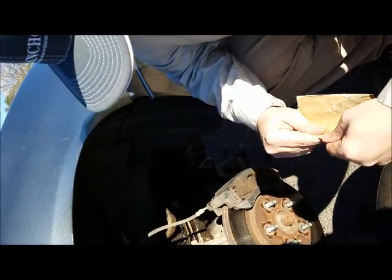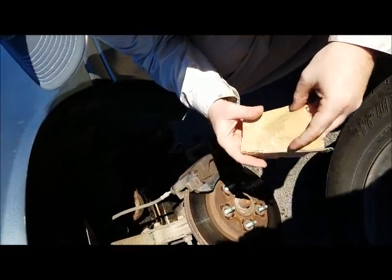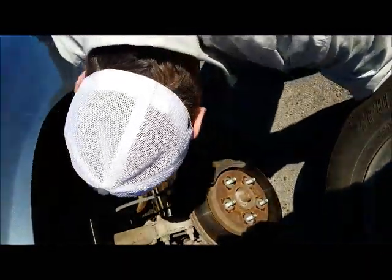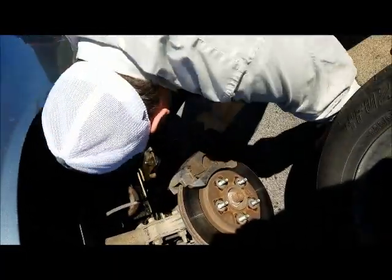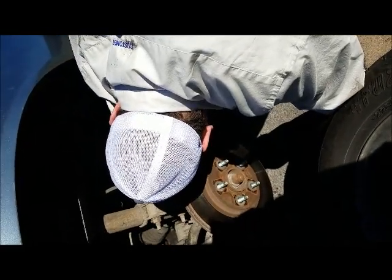So we're gonna do that, and then we're gonna reapply the JB Weld and let her cure. And I think that's gonna be good. Now, when it happens later on, after it totally cures, we'll start it. And if it doesn't leak, then we're gonna go ahead and buy some rubber tubing and some hose clamps, and we'll cut the rubber tubing and make a sleeve for it, and then we'll put the clamps around it. Because really the tubing and all that stuff is just for protection, to make sure nothing rubs against the JB Weld. So, all right, signing off.